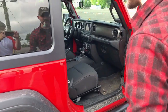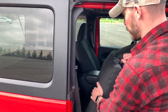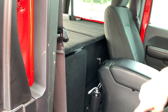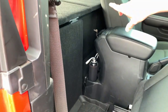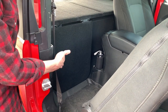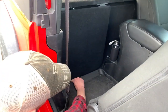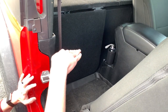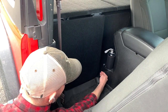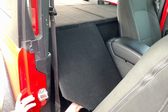Looking inside the Jeep, I'll show you how the sleeping platform works. Using the top lever to move the seat all the way forward, I've made the sleeping platform fold down that uses the entirety of the footboard. I had to cut around all the pieces at the bottom to make sure it had full clearance. There's a bump you need to clear, and when it's up, your feet can fit there, so it goes all the way to the bottom. This curve clears this piece, and when you flip it up it just clears the seat.